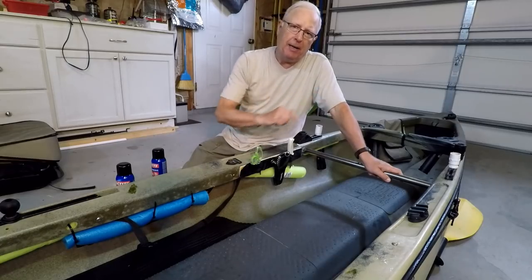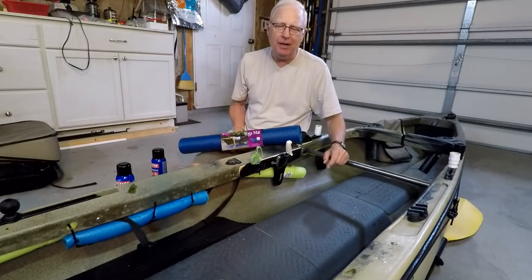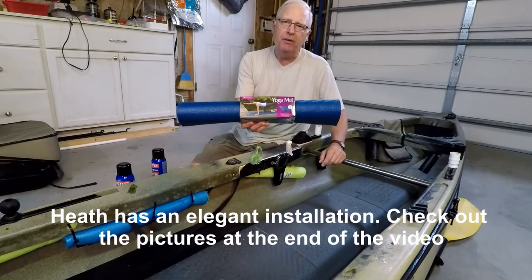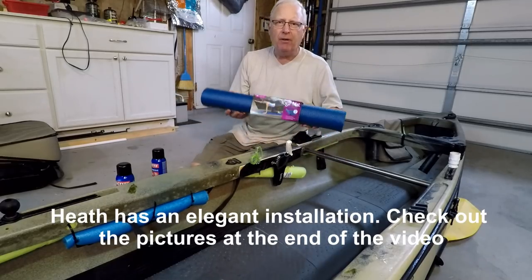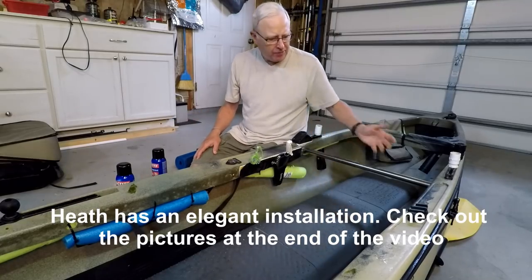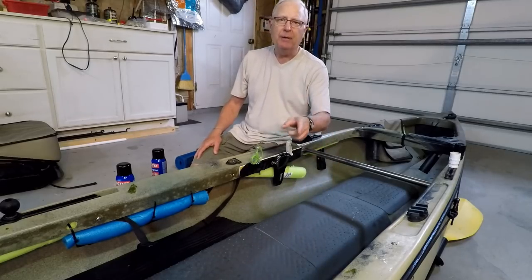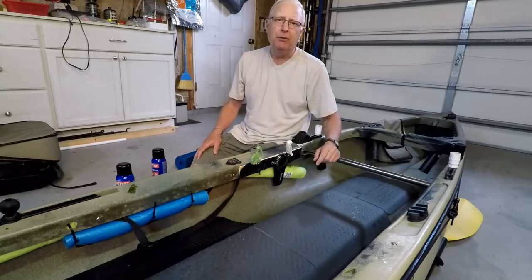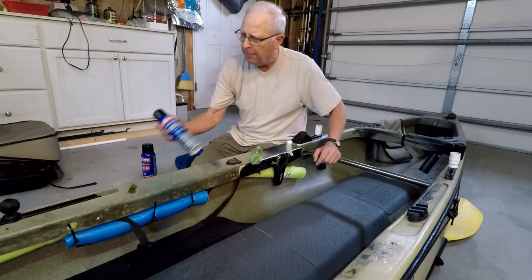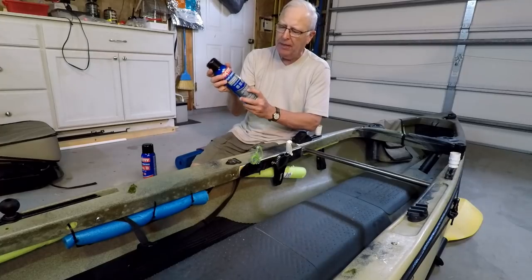For option two I'm going to follow one of my subscribers' advice — a guy named Heath Holland. He found one of these cheap yoga mats at Walmart that cost under eight bucks, and they're a lot lighter than the heavy set of car mats I installed before. I'm going to pull those up since they're not adhering that well anyway and redo it. But I'm going to take a different approach to adhesion this time: instead of using the 200 level of adhesive, I'm bumping it up to the 300 level, which is heavy and claims it bonds — maybe it'll stick better.